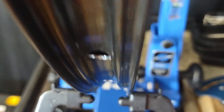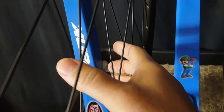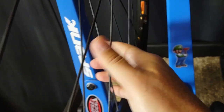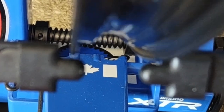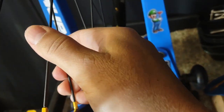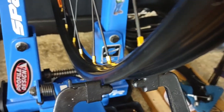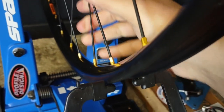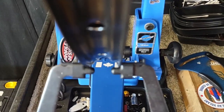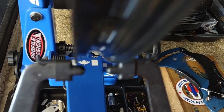I don't see any problems here — this is totally workable. There's a little bit of pull to the right, that's going to be the disc side normally the way I put it in the stand. There's still some flex in the non-disc side — a fair amount of flex. We've got a little hop that's developed here. As always, we're just going to go around the wheel, just fine tune, find our spokes. At this point you can just see what's loose and what's not. We have a little bit of radial rub. Found some loose spokes. That pulls a little bit over to the non-disc side. Seems to be doing all right — we're tightening up on the non-disc side.